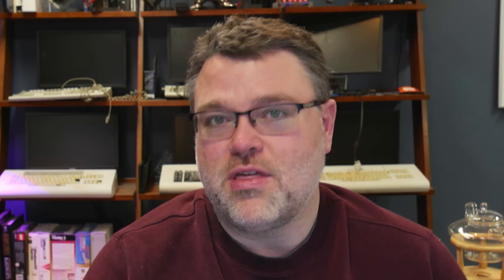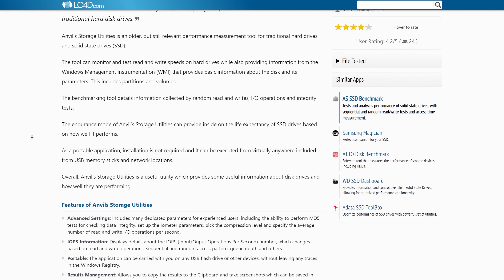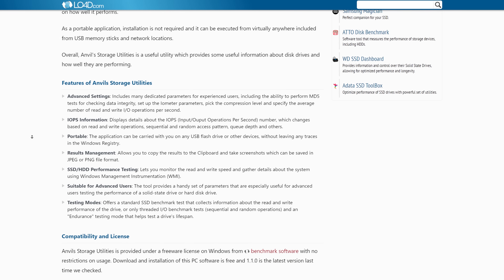In all reviews, everybody does some type of preconditioning — sometimes involving writing an absurd amount of data to the disc, like with Anvil, as we've done in the past. But with SP Random, we don't have to do quite as much random writing, and it works great on larger SSDs too. As we move to 32, 64, 128, and beyond terabyte enterprise drives, things are managed internally on the drive not in 4KB sizes but in 64KB or 128KB sizes. That changes performance, because to the operating system it can look like 4KB when in reality it is not.